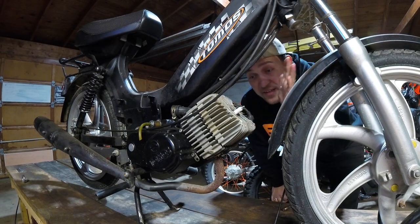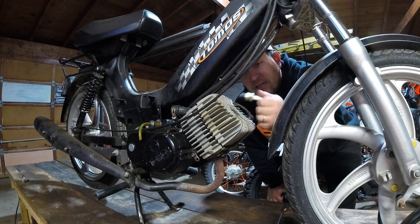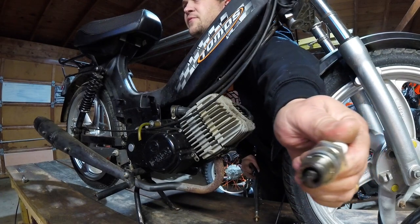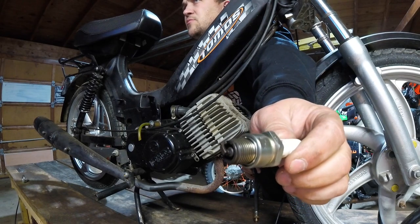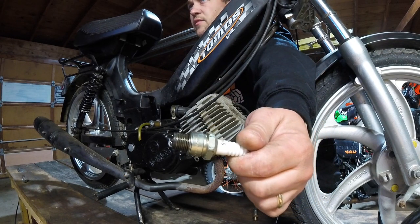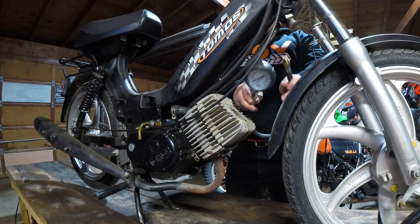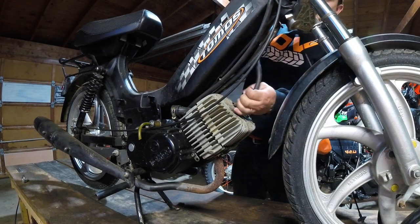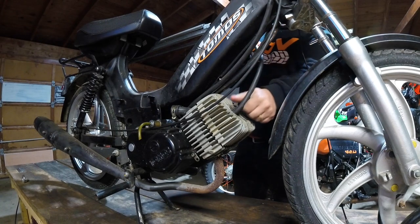Our next bit of kit — I literally have not touched any of this yet. This was finger tight. Spark plug — meet camera. Now, that's kind of a good sign. The color is darker; you don't want a big white, super hot plug. That means she's been getting too lean, which means air leaks or bad fuel mix. This is pretty dark, which is better than not. That's what we like to see. Let's get the compression tester in there and see what we've got to play with.